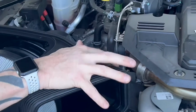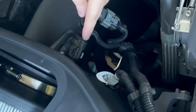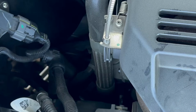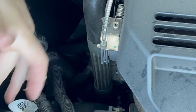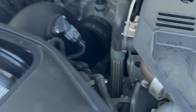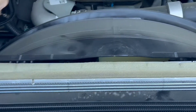Okay guys, so now that we're nice and secured, we want to check the connectors. What we want to look at is on this elbow, when you install it, it's going to want to face the opposite way. The instructions from S&B will show you how to pop open this collar and flip it to this orientation. That way you're not pushing the wire against the box. That's a big, major key component. So just make sure you're doing that. The next thing we're going to do now is re-add the ram air from the stock box that brings in the cold air in here.